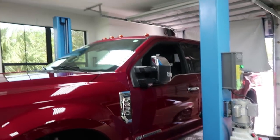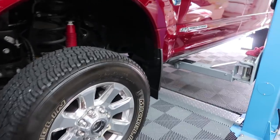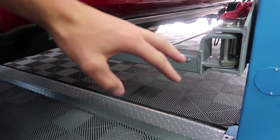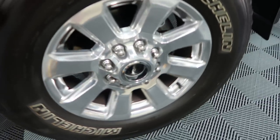So what I did this time was basically line the mirrors of the truck up with the lift so that way I have less weight over the front. And I just lifted the front end of the truck — not much. I don't really like using the lift like this with only one foot because it has a tendency to actually roll back. By one I mean two because there's one on the other side. So I have it just high enough to be able to spin the wheel. The main reason why I'm using a lift is because my jack really doesn't go high enough, and ideally you should have both sides of the truck up at the same time, especially when you're working with a sway bar. I am warning you, I have to have the door open because of this, and it gets extremely hot in here when I don't have AC sealed off. So I'll probably be drenched by the time we're done.